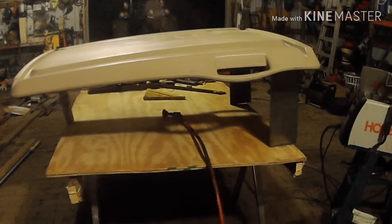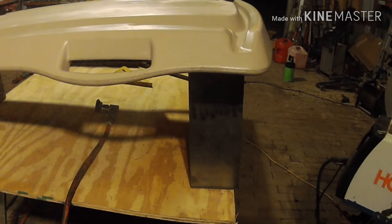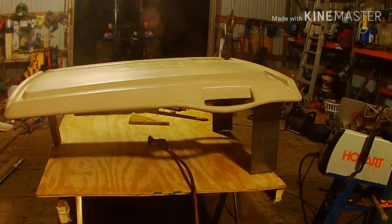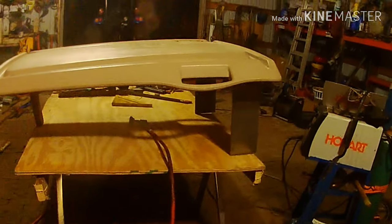Here's the top sitting on the frame. I'll put those U-bolts through these panels into the ROPS. They'll be at a kind of weird angle because the ROPS leans forward a little bit, but it should work out okay. Now for the important part — do the holes still line up? They might need a little pulling, but they line up. It's got a little bit of movement in it. The next step is to sit it on the tractor and measure for the U-bolts going across exactly where I want it.